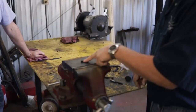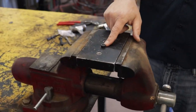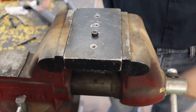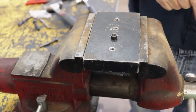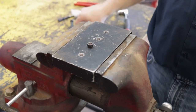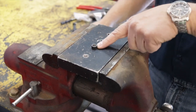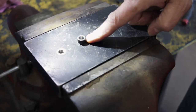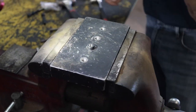What I've got here is a demo block, and in that demo block I'm using a cap screw - but let's say for argument's sake that I've snapped the head off a bolt and I've drilled a hole, which is what we have here. It's not just about cap screws; it can be used on broken studs, anything like that. I use a cap screw to demo because it's easier. We've snapped our bolt, we've drilled our hole, now we're gonna pound our extractor in.